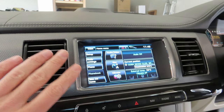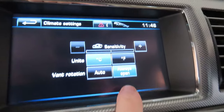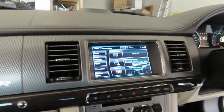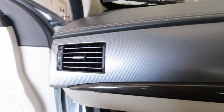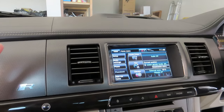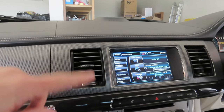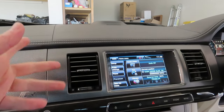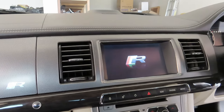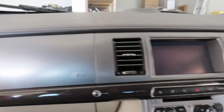Before you begin, just make sure you set your registers to the open position. To do that, go to climate settings and select 'always open' instead of 'auto,' so when you turn your car off your registers will not close. The reason we're doing this is so that your registers maintain their current memory. If you don't do that, over time one's going to be closing faster than the other, and you'll need a technician to plug an OBD2 in and reset and relearn the registers' opening positions.